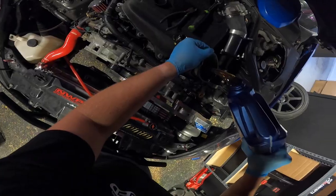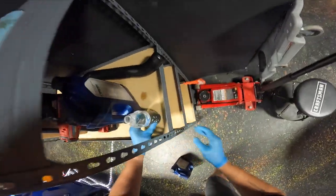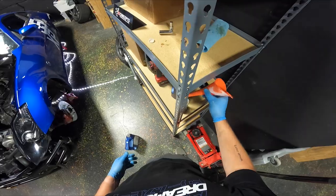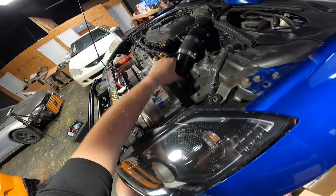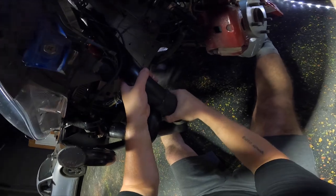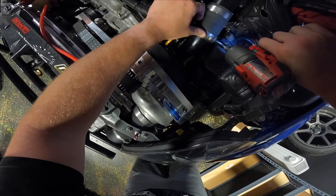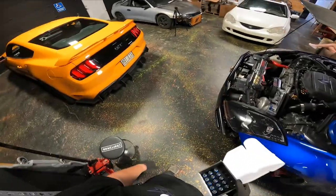Now the engine oil — Rotella, that diesel oil. That was almost a big mess. I still got to put the charge pipe back in. Shove that back up in there — this is down here and we need it to go forward. A way to make it go forward is by loosening this and shoving it on more. That's being pulled forward as much as possible, so it shouldn't hit the wheel. All that's left is put the wheels on and take it for a test drive.